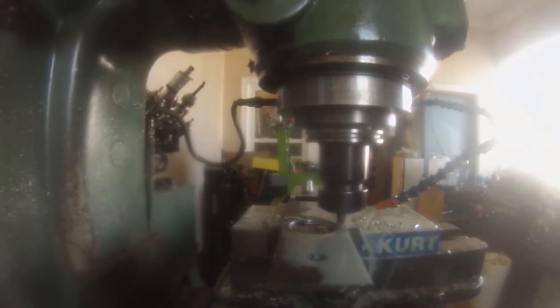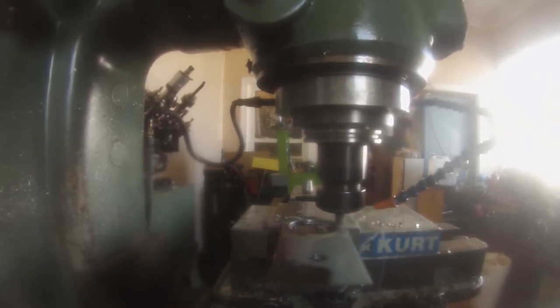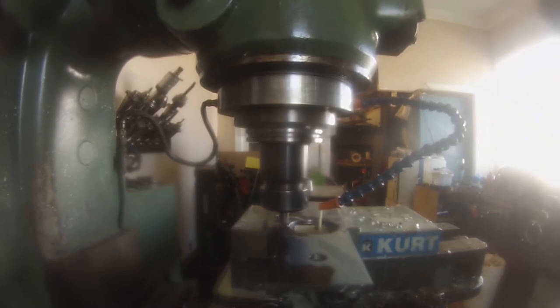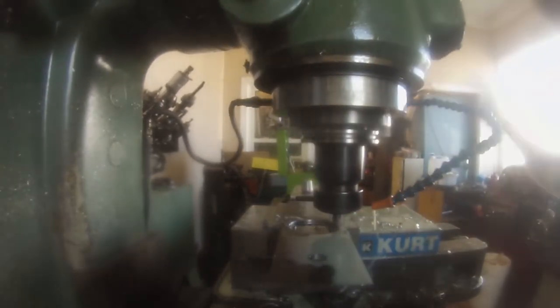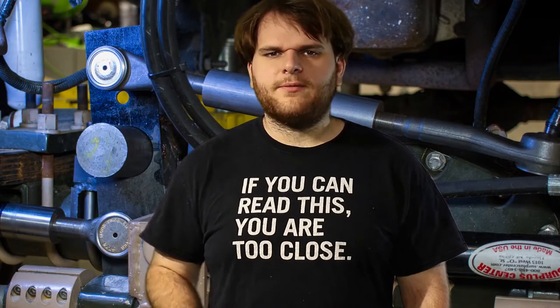So I make a second template. This one is out of quarter inch plate. Besides cutting center and lower tie rod end holes, I mark center. I do this with the use of a 45 degree chamfer bit on my mill. It cuts a small groove into the plate. Once I find the upper tie rod position, I can use the center mark to precisely measure its location.